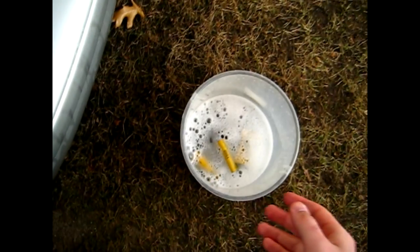What you want to start with first is getting some soapy water on the light to provide lubrication. You can do this with just normal water but soap adds a little more lubrication when you're sanding and does a nicer job. So first I'll start with 1500 grit and just keep sanding slowly. Take my time — try not to rush this.